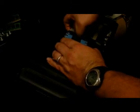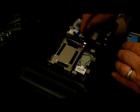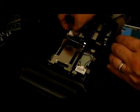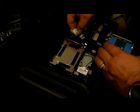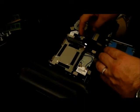There's a piece right here that's trying to come off, so take your nail and get in there and just pry it off without pushing it back on. Be careful you don't pull this cable out — I almost did. If you do pull it out, just push it back in, but if you pull it all the way out it's going to be harder to reinsert.